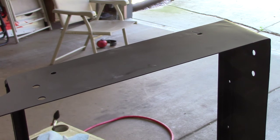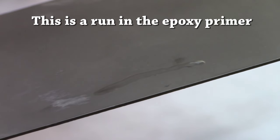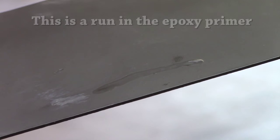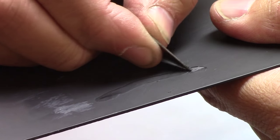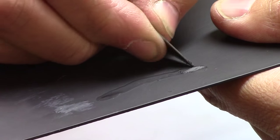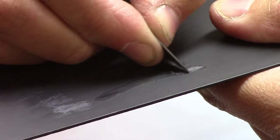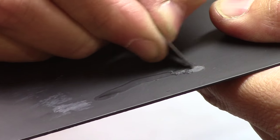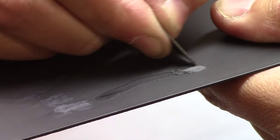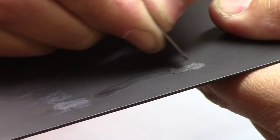On this panel there's a little run there, and I've learned from watching YouTube and car TV that you take yourself a little razor blade and just work it down. So far there's been, I think, the second one. And so I'll just take my time, work this down, get this baby primed and painted.